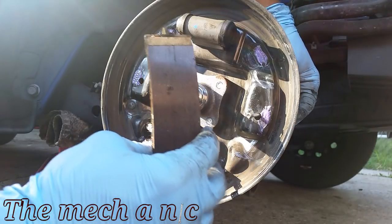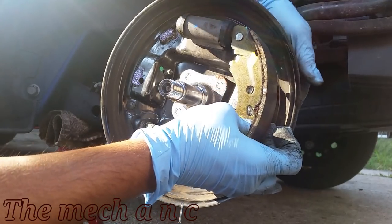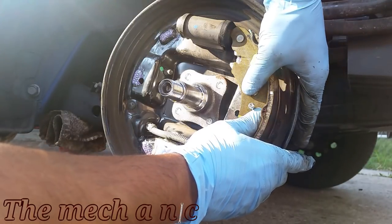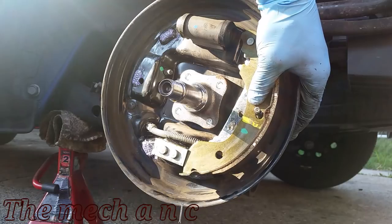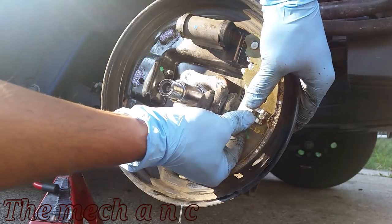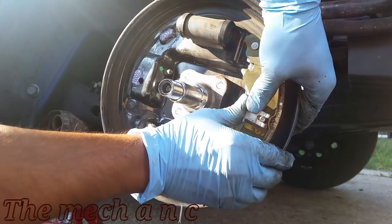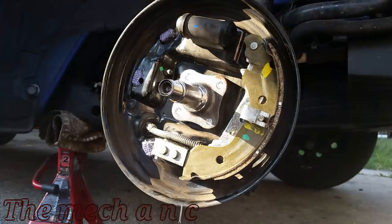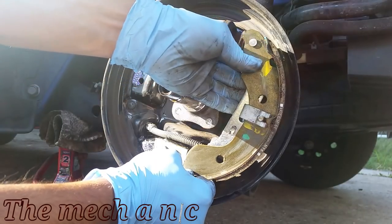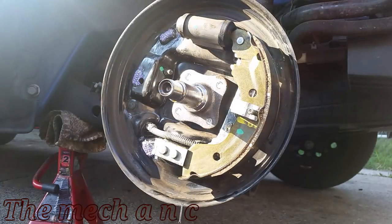Grab the pin, put it through the back plate first, then set your brake shoe on top of it and try to get the clip on. A little trick: you'll see a valley all the way around the diameter of the backing plate where it dips down — if you put the brake shoe inside of there, it sits much closer to the backing plate than it normally would, and you can actually get the clip on just by squeezing it with your fingers. That only works for this side. Once the clip is installed, lift up the brake shoe and get it back into its original place — it's sitting farther back than normal, so give it a good yank to pop it back up.